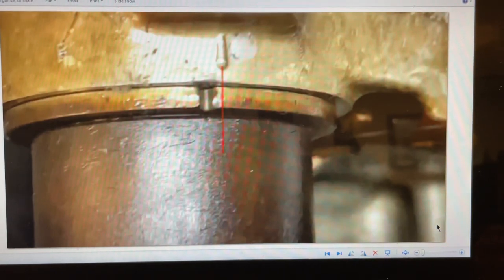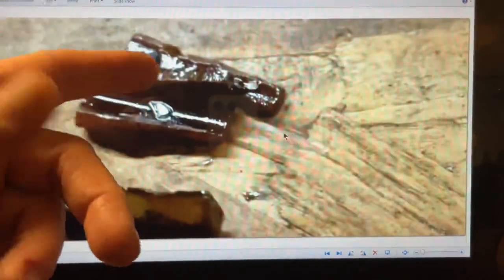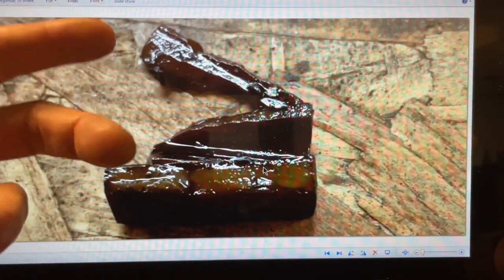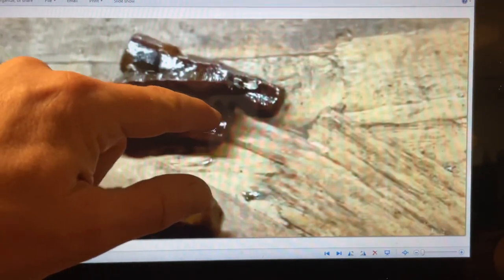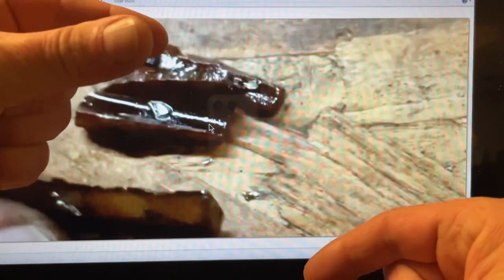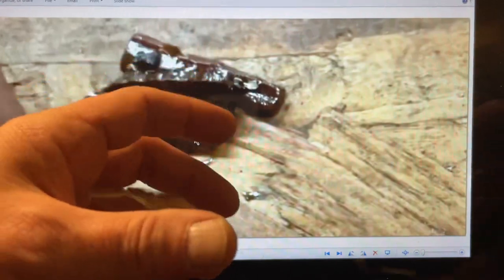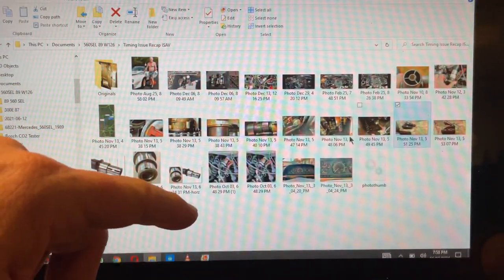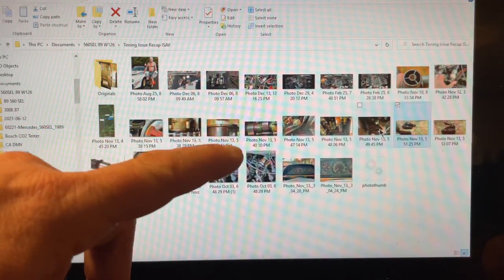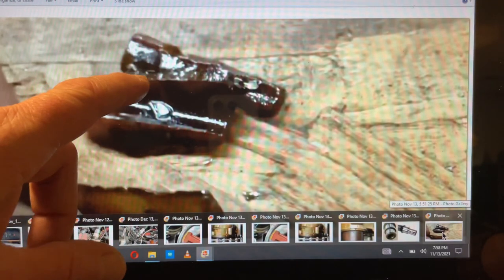The engine probably had some parts replaced at some point. We know from the past it had a broken timing chain — these are the parts I found in the oil pan and oil strainer, and you can see how bad and brittle they were. This is where the pin goes through on the bottom of the chain guides — one of the chain guides broke. Since it's a holder with two pins, it's most likely the one on the driver's side, and that wound up in the oil strainer. That tells me they fixed the timing chain and may have fixed other things.